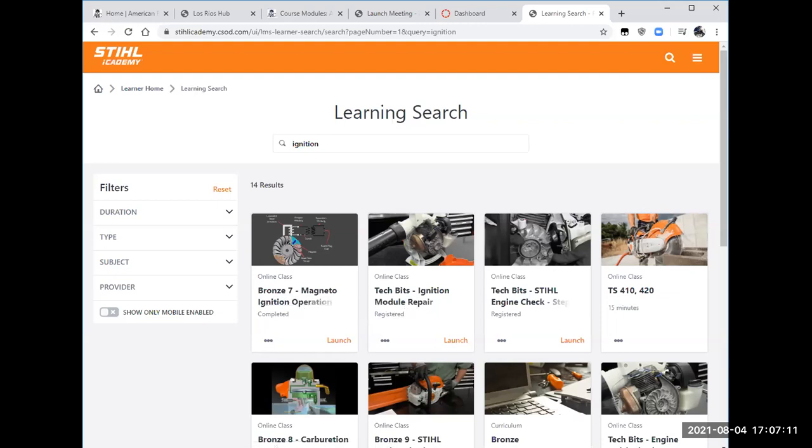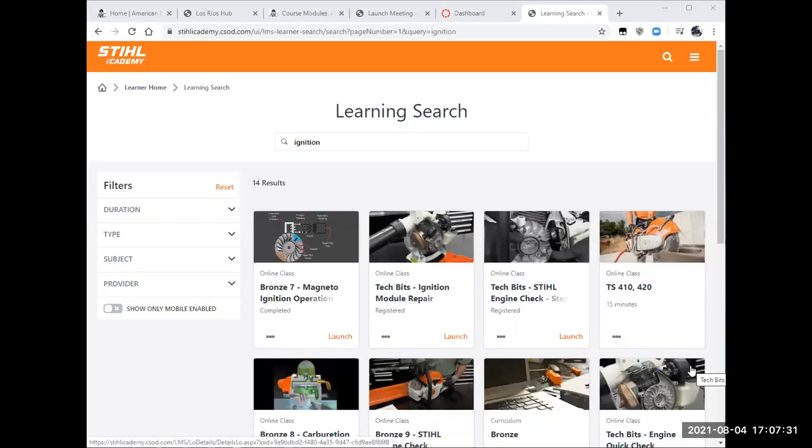Even a little battery like this one in my hand here would add a considerable amount of weight to the engine. In fact, let me stop my screen share real quick. There we go. So even a little battery like this weighs a couple of pounds. And if it's something handheld, that extra 2 pounds is not something I want on my device. So the advantage of a magneto style ignition system is I can fire my spark plug without having to lug around a battery on my device.